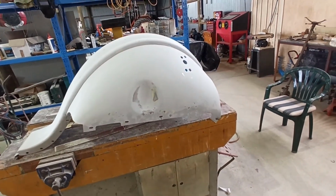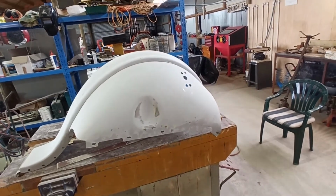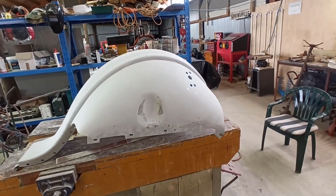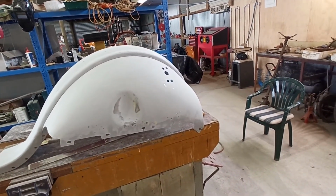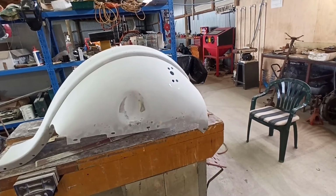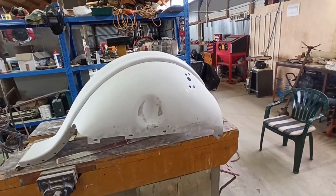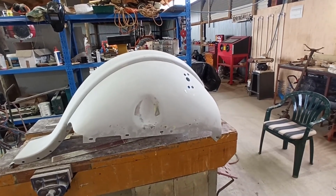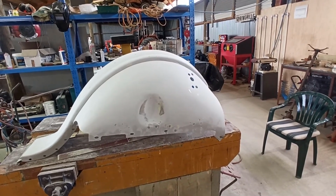And it's got to be sanded on the inside as well. I don't have to probably sand it on the inside to paint on the outside, but it needs a scuff up on the inside if we want to put a little bit more product on there. But this is going to be stone guarded inside, so it's probably not critical. We'll just give it a scuff up when we need to, and blow some stone guard up in there before we paint, do the last coats of high build sort of type thing.